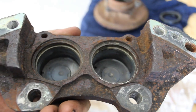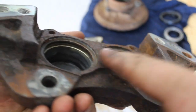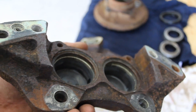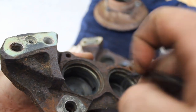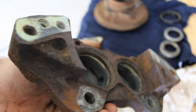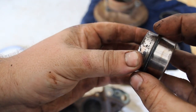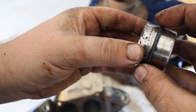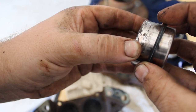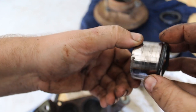For those of you who haven't seen inside a brake caliper, they're super basic. In this little groove there are square section seals that sit in it, and they are what return the piston. The top groove is literally just a dust seal. When you put your foot on the brake, the piston comes out and rolls the seal like it's trying to pull it out of the groove. When you let your foot off, the seal resets and pulls the piston back. That's all there is to them.